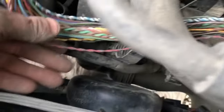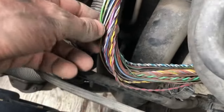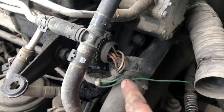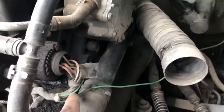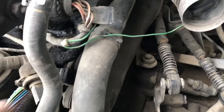So maybe if I repair that, I'll solve this problem. I did see some chafing on some of these wires, so I'll rewrap them with electrical tape and then put on a new piece of loom. Over here for the injectors, somebody else has already run a new wire — I don't know exactly where that's going, but there must be another broken wire in this harness somewhere and they just resorted to that.